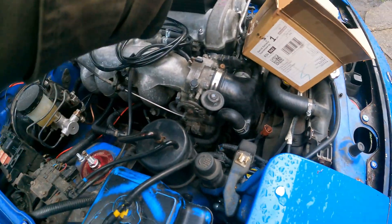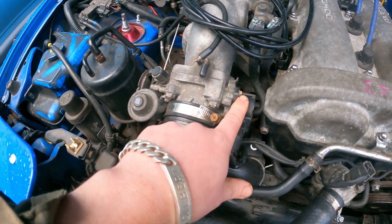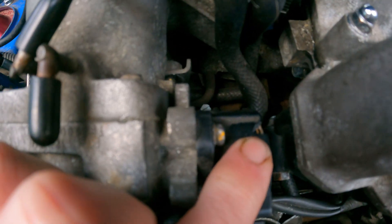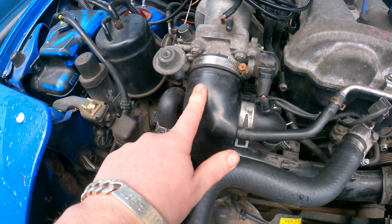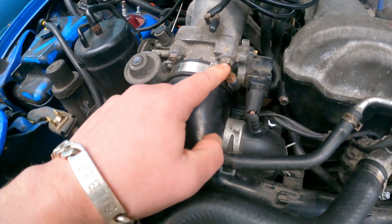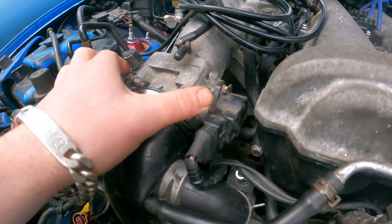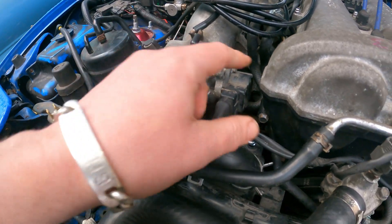That sensor won't just pop out even if you remove the bolt, because there is a bar that gets into it. I've also noticed mine is actually cracked. So what we need to do is unplug it — the bolts are I believe 12mm, I'll put it on screen if I'm wrong — and then move the throttle body slightly off to clear the head so we can pull the sensor out.